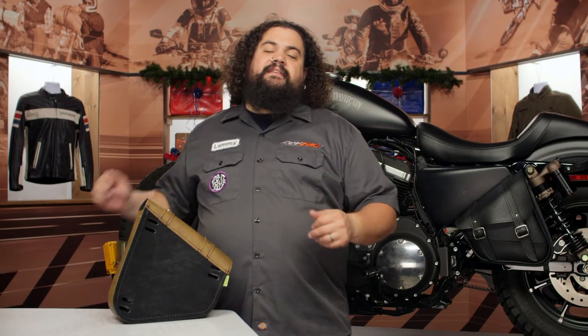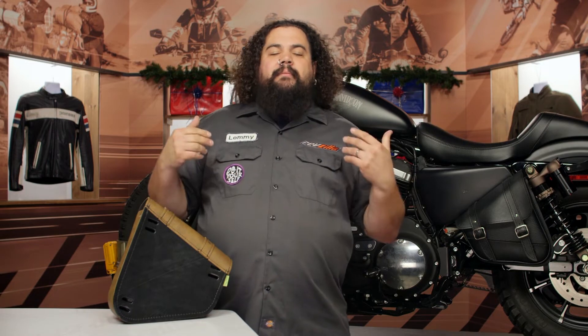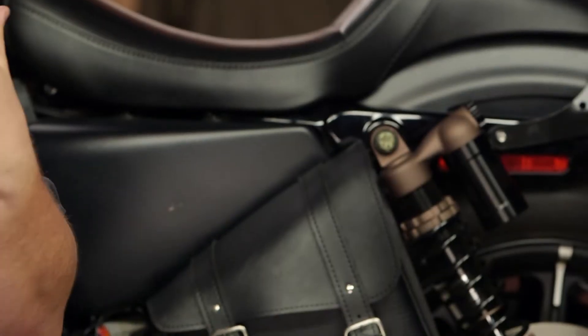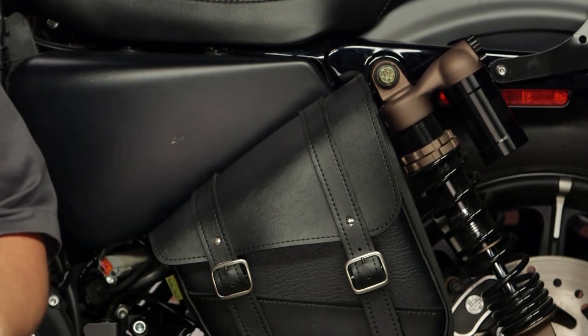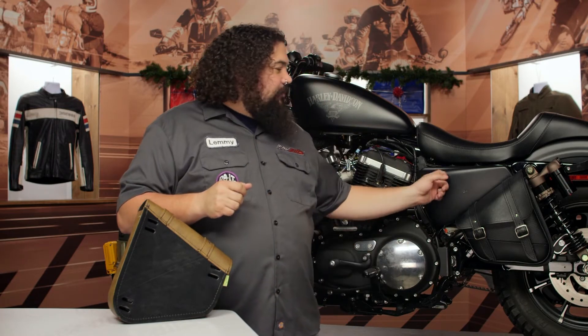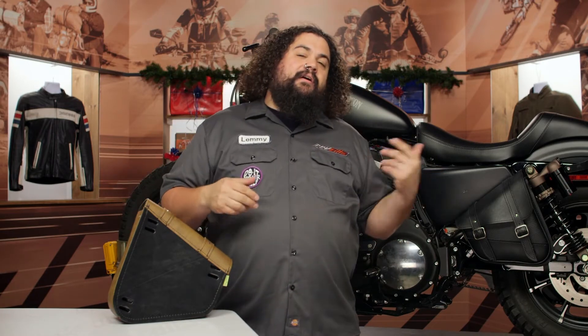You should be aware though: if you're gonna put one of these on your bike, you will probably experience some rubbing based on the mounting and attachment points — that's pretty par for the course with a leather-style swing arm bag like this one. Other than that, installation is pretty straightforward and you should be done in about 30 minutes. You will have to pop off your side cover if you have one in order to get this onto your motorcycle.